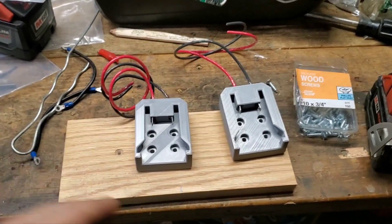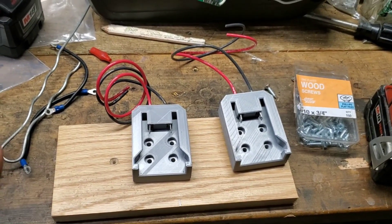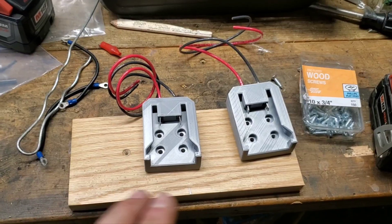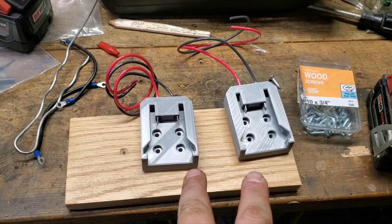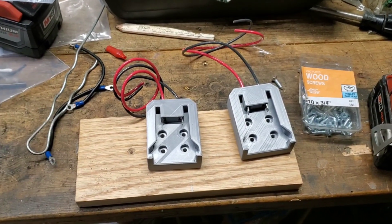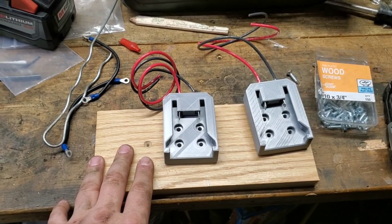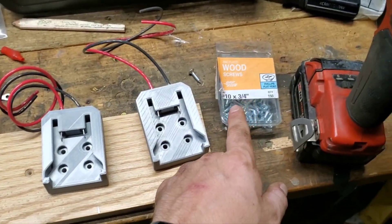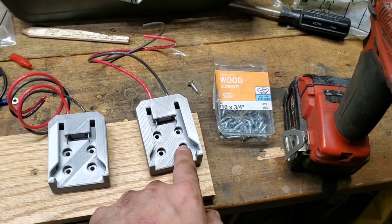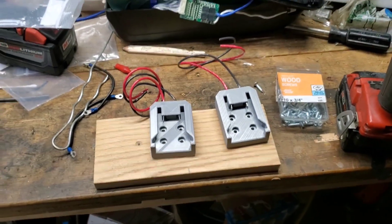Here's how we're going to mock this up — I've got it all measured out with my center marks. I'm going to put two adapters on the end. I'm mocking up three of these: two are going to be wired in series for the drive, and the third one — I'm already using Milwaukee to power the headlight — will be mounted on here for the headlight. I'm going to use number 10 three-quarter inch wood screws that fit perfectly through these holes, which should give me plenty of holding power. I'll go ahead and screw those all down and show you when we're done.